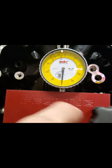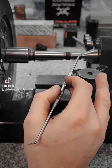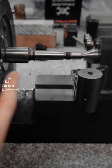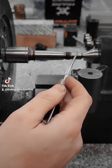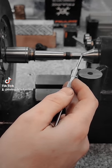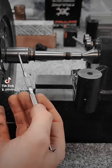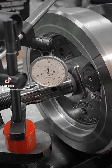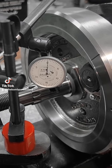That tool uses a thousandth indicator to measure runout on the very end of the pinion shaft. When we're actually building new flywheels — like the stroker flywheel assembly for a 1969 FL — we're measuring in a truing stand. Instead of the bearings holding them steady and measuring out at the end, we do the opposite: we have centers that go into the end of each shaft. Those centers keep the shaft stationary, which means our movement is actually measured here at the bearing surface. We want to pull our measurement as close to the flywheel half as possible, because that is where we'll see the most runout as we're rotating.